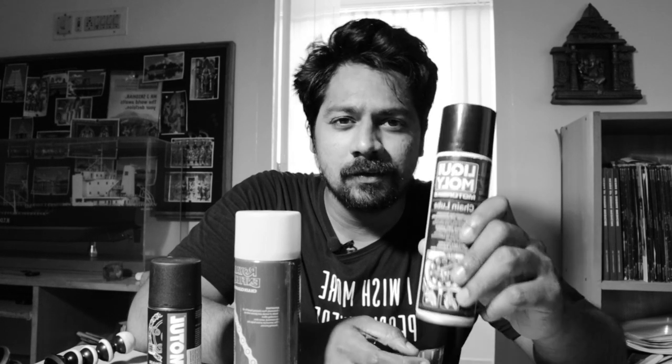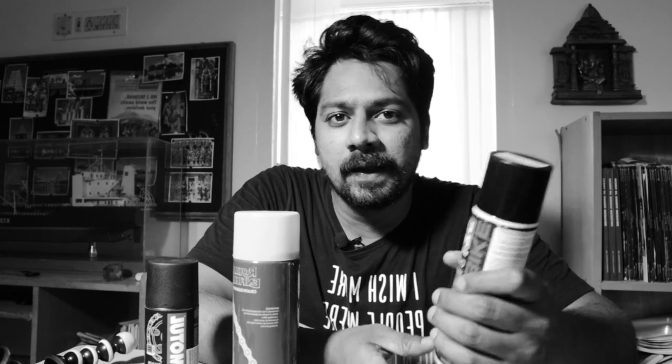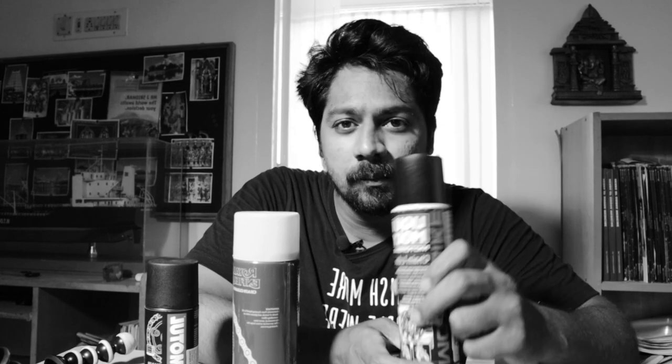The next thing you would need is a chain lube. I purchased this from Amazon — it is called Liqui Moly. This is a bit expensive compared to the Motul chain lube. One advantage I'd like to share: if you are using a Motul or Royal Enfield chain lube, the ideal interval to reapply is around 400 to 600 kilometers. When using Liqui Moly, the interval ranges from 650 to 750 kilometers. This would be a safer bet if you are a regular tourer, since you can't stop every 500 kilometers to relube. If you travel around 700 to 800 kilometers a day, just lube in the morning and you can ride all day, then relube at night.